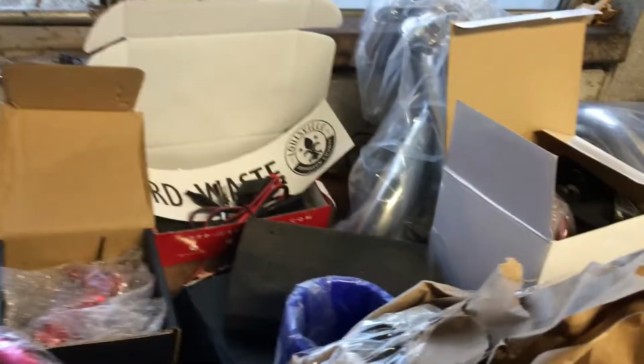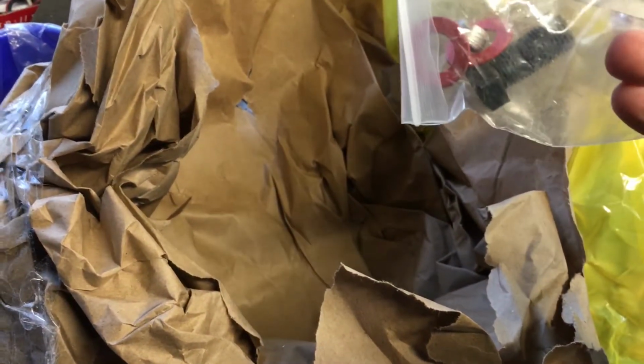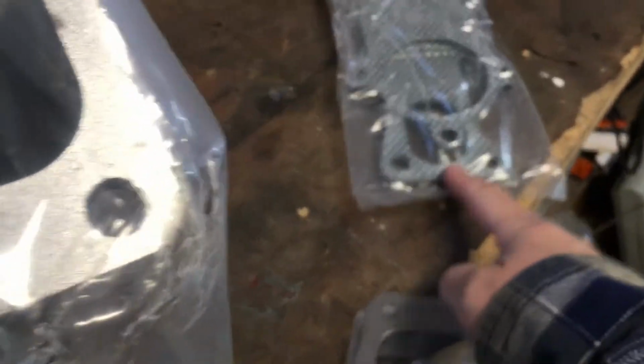Expensive item in the kit. Packaged in the yellow bag. Nothing there. Get the bag out of the way. Okay, hold on. There, we've got some gaskets. Yeah, we got gaskets. We'll need those. It's a nice steel gasket instead of these. Because these things, if you use them on a turbocharger flange or a wastegate flange, they burn through just almost instantly. So a nice steel gasket like this is good. It's actually really good. Let's set that down.